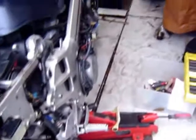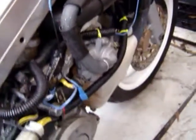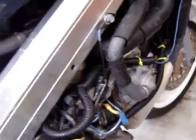Okay, the valves, the carburetor has been very problematic. I have a vacuum leak at the coupling area, the coupling boots and the carburetor boots. I've gone ahead and fixed that. I could not sync the carburetors my last attempt, and it burned out my battery.